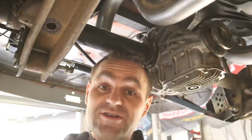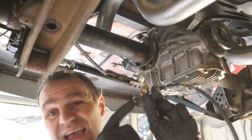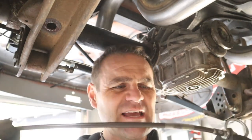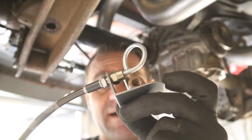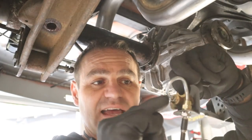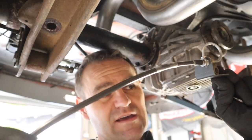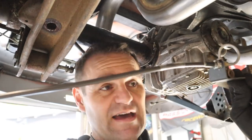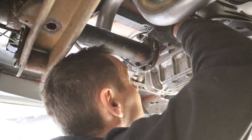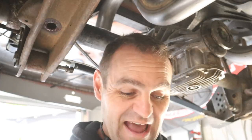I spent a lot of time making a bracket to turn this piece 90 degrees, then realized that the flex hoses I got - which are supposed to be for this car - are a different fitting. So instead of doing that, I made this bracket which bolts on the original piece and then just has a hard line that goes around to a bracket that reinforces it so it's not putting too much pressure on that hard line itself. Then just run the flex off of that, so it gives me my 90 degrees without doing too much. That should clear the exhaust at full bump - we'll see.